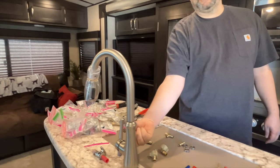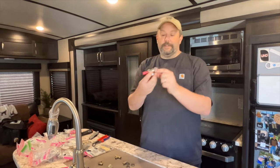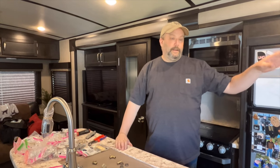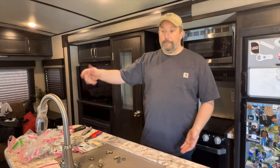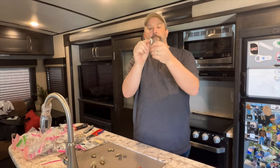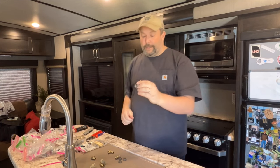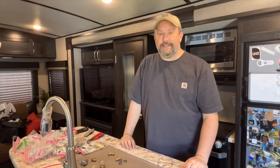Another time we had a leak under the sink — I couldn't fix the faucet directly so I went underneath and put a shutoff on the flex line. The main places to look are underneath your sinks, in the pump compartment, and near your water heater. When you look in there to bypass and un-bypass your water heater, all those valves are the same type — probably plastic. That's what you paid for when you bought your camper, so at some point you might want to change them out to stainless steel or brass.